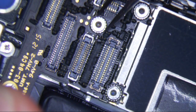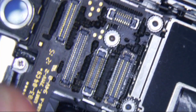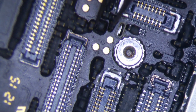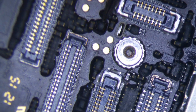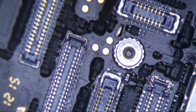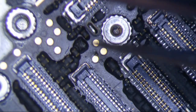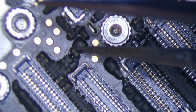I don't even do long screw damage. But I do know that this camera is messed up, and here is the camera LDO right here. This handles the voltage that powers the two cameras. I notice that when I push on it a little bit, there's a little bit of play in it. So I know it's loose, and most likely if both cameras are bad, then this LDO is disconnected from the logic board. That's my guess.